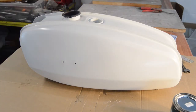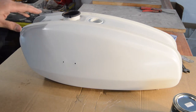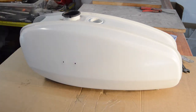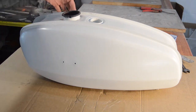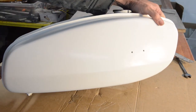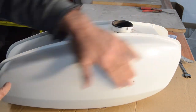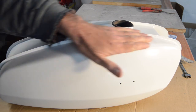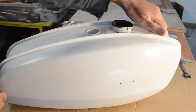The tank is actually in the white base coat at the minute, having been re-primed and flatted. Unfortunately the paint has reacted on one side - let me show you - there's faint wrinkling there. So it's going to have to be left to thoroughly dry; must be some sort of solvent problem. It'll be thoroughly dried and then re-coated.